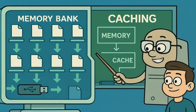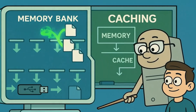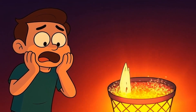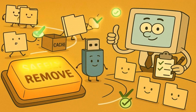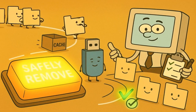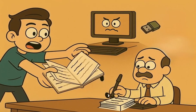The computer also uses something called caching, where it saves changes to its own memory first before copying them to the USB stick later. If you pull the stick out before that transfer happens, you lose your work. The safely remove button tells your computer, "I'm about to take this out," so it finishes any pending writes, clears its cache, and makes sure that everything is safely stored. Skipping this step is like snatching a book away from someone while they're still writing in it.